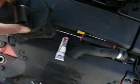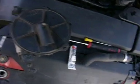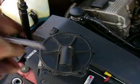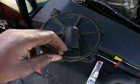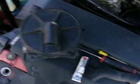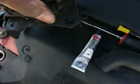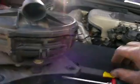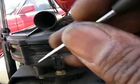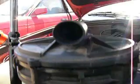You drill your rivets out the top of your pump or whatever the case may be, and the rivets are like this. We just drill these out of the holes, and all 6 of them, and we took the top off. Before we do that though, we mark the clock position of the smog pump like so. We just scribed a little mark on the body of the pump so we'll know where the clock position is.